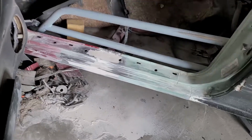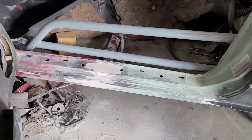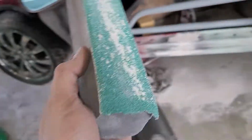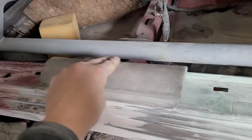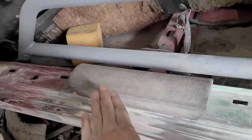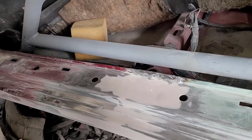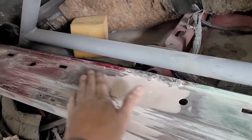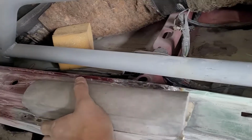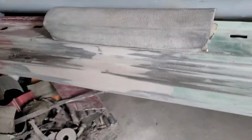Got a little bit of a pile going on the floor. It took me about, let's see, 20 minutes to do. I used my long block, like I said, with the 40 grit, so that it cuts straight. We're not digging in weird positions. Like if we were just using a piece of sandpaper, I could be digging in right here and not spreading the sandpaper over evenly. So use a long block to sand everything evenly.